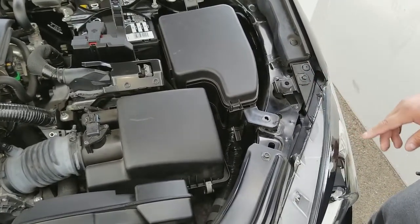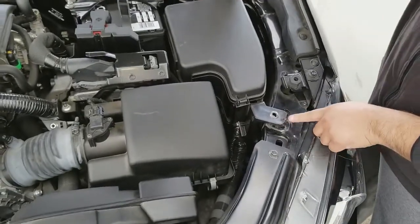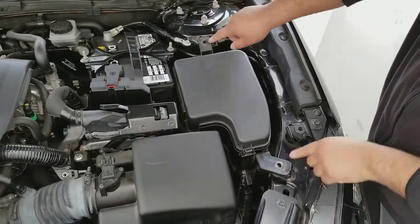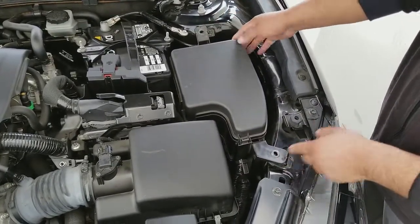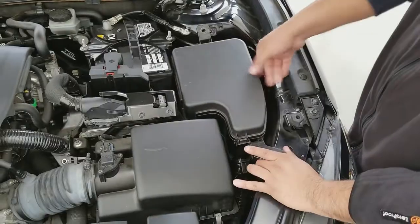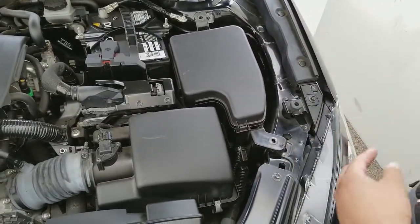passenger side. So the way I like to install these is that I remove the two locking caps, or like screws that go here, nuts. Remove these, they're 10 millimeters. Once you remove that, you can actually pull the whole fuse box to the side, and you should be able to stick your hand through here to pull out the original.